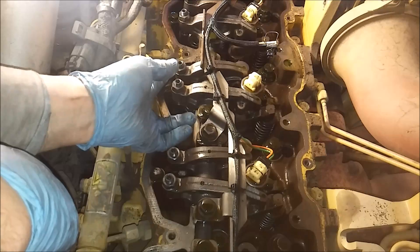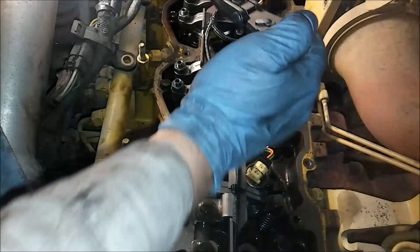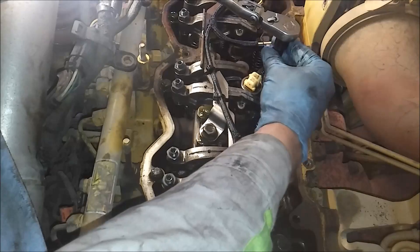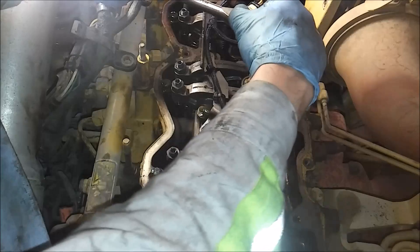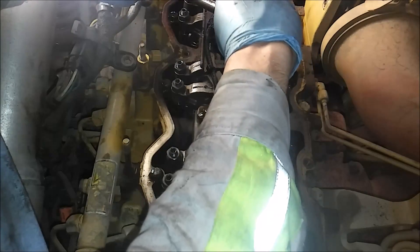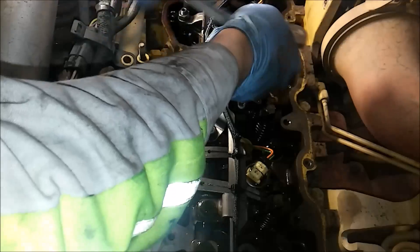You can feel the alignment port in there - stick your finger in the quill tube bore. So next thing we're going to do is remove the injector. On these it's just a single hex internal hex head bolt. We're going to de-torque it and loosen it up. These only torque to about 20 foot pounds, so they're usually not too bad to get out.